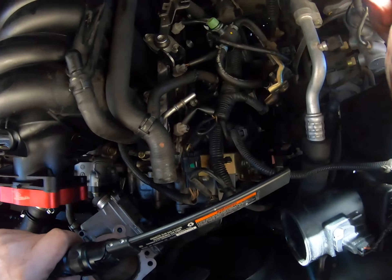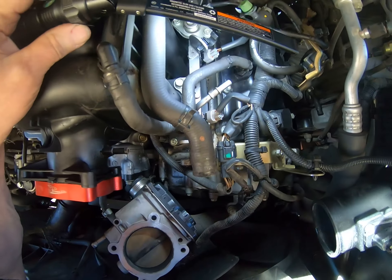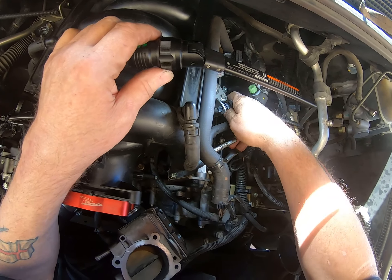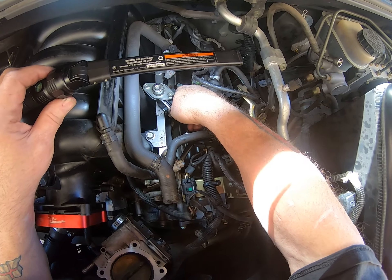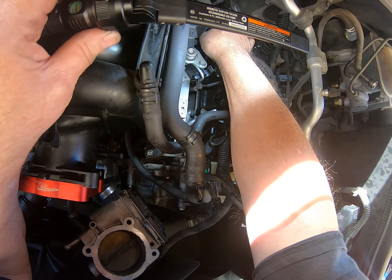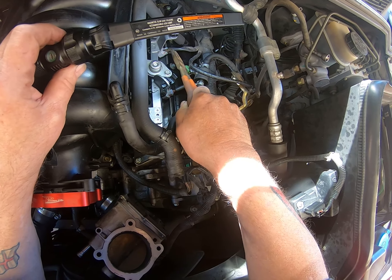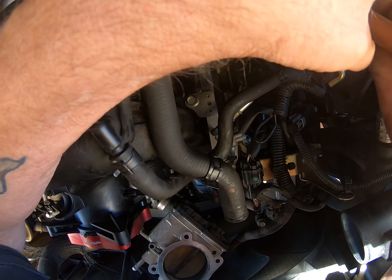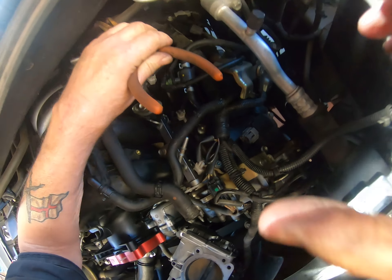Next will be to get these injectors — to undo the injectors. For that, there's a little plastic squeeze on the other side. You squeeze them and give them a pull, and they don't all come off as easy as that, I can tell you. This is an eight-cylinder, so there's four each side. Sometimes you have to use a little persuasion. Being crappy plastic, I don't know if it's going to break. There we go. I'm not going to let you watch me doing the rest of those.